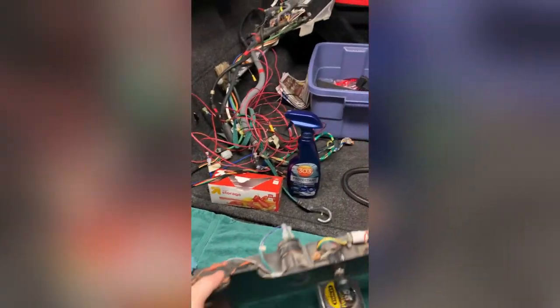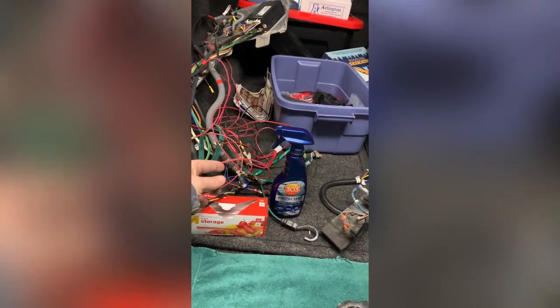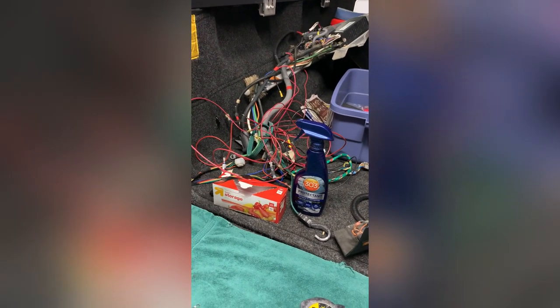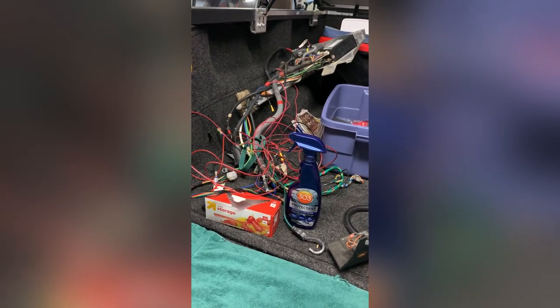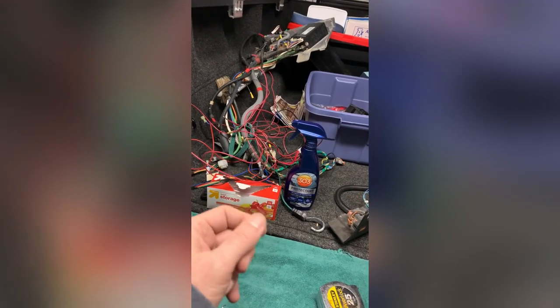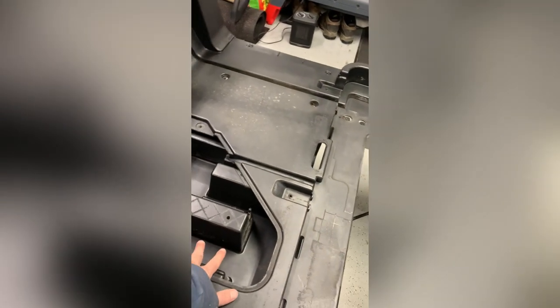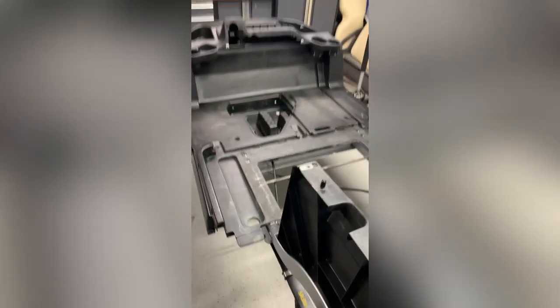There's the wiring harness for this cart. Don't mind all the red wires — when I bought it, it had headlights and taillights, and this is pretty much everything for the back half. It has a real harness for the front half, but everything that went to the back half was just those red wires. So I bought a full headlight kit off Amazon — supposed to be the deluxe model. I like it because the stick on the column has headlights on and off, but it came with the pedal pad rather than the mechanical brake light. The mechanical one is just better — it mounts in here and when you press the brake it pulls the rod forward and turns the brake light on. It's missing the timer though, so I'm not sure I can use that.